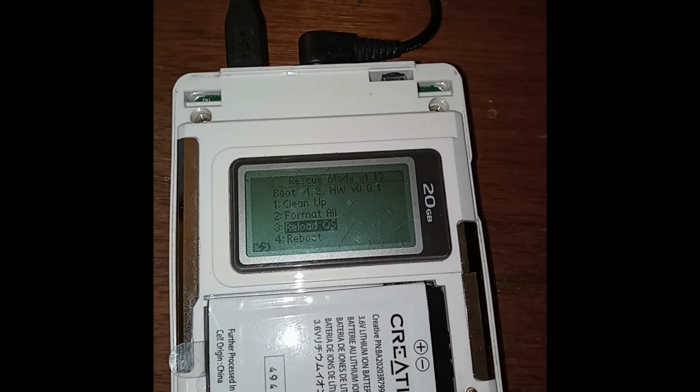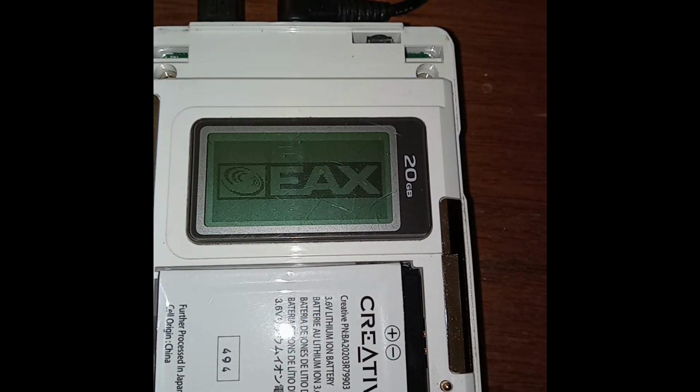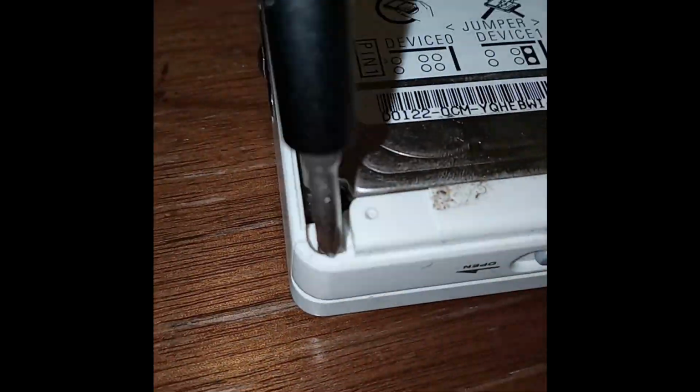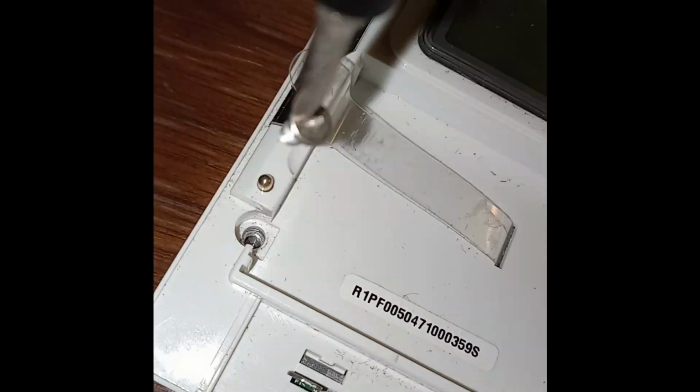As a side note, the firmware flasher does work on Windows 10, but the driver that allows access to the player's library still needs something like 2000 or XP. The bottom piece of the player with the faceplate switch secures the hard drive and PCB assembly from the back, and 4 machine screws secure the hard drive and PCB together from the front.